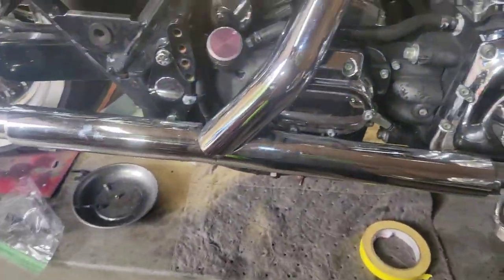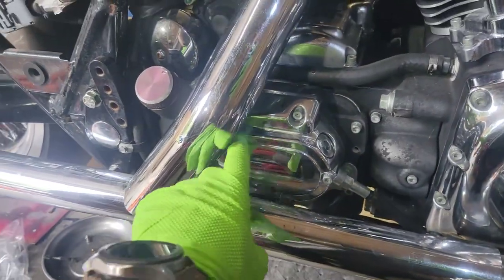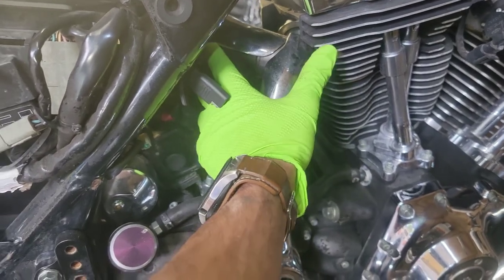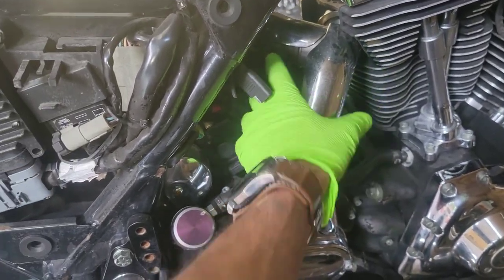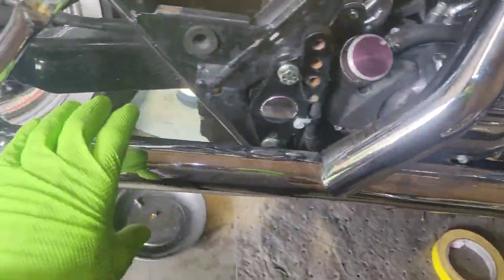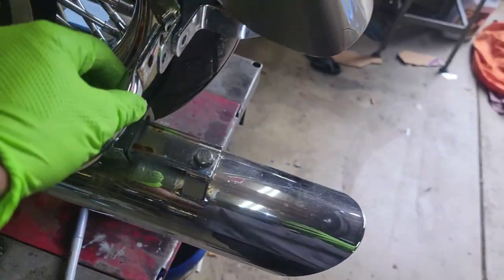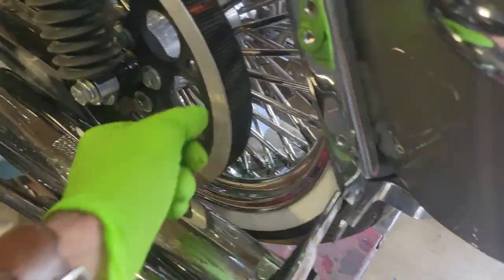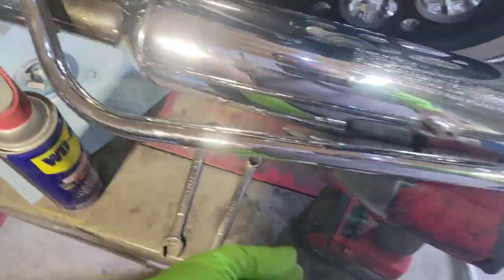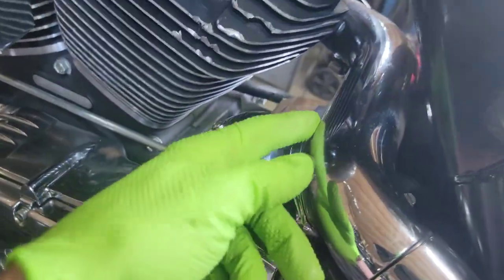The nightmare part is the clutch cable. This exhaust isn't gonna work with me at all as far as getting that cover off. We've got to break the exhaust loose — there's a breaking point and then it slides out. I think we can avoid pulling that floorboard off by just pulling this out and getting it out of the way. On this side I found it easier to just take off the bag support and leave it loose for a second while we slide this piece out.